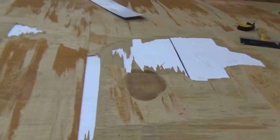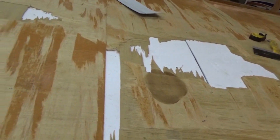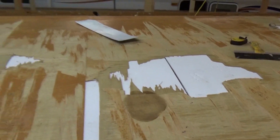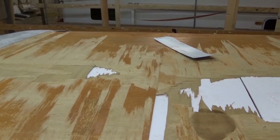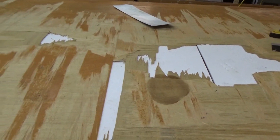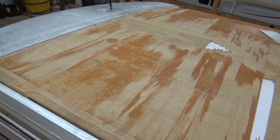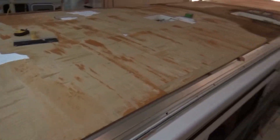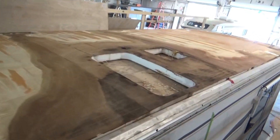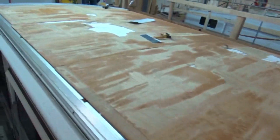You don't want to start peeling that up. Some guys watch the videos and think they can do some of this stuff by themselves — if you want to tackle that, do not keep ripping it up. You'll just take all the integrity out of there. If it's loose, it's loose; if it's not, it'll stay tight. It acts as a structural component — it's all laminated together. Don't try to keep peeling it up and peeling the foam out. You just got to work with what you got; that's the way it was designed. You start doing that, you'll open up a bag of worms. You just want to skin over it.